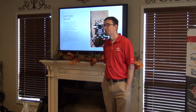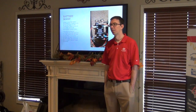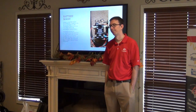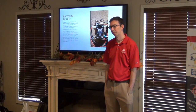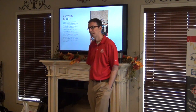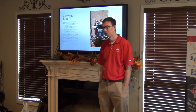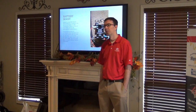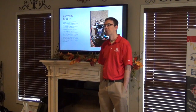What it's doing is it's connecting the two banks of batteries together. I let the batteries run down, the keys were inside, and I couldn't open it with the remote. I called you guys and someone told me to take a 110 wire and plug it into one of my receptacles and backfeed — I put enough charge in the batteries to open the door. I plugged a 110 into one of the receptacle boxes in the basement, put two male ends together, ran the power back through it, and it let me open the door.